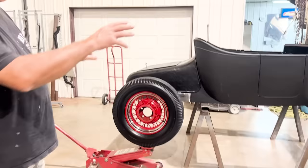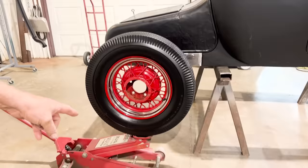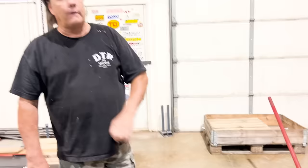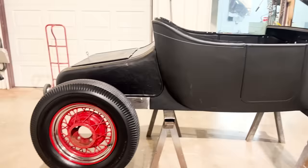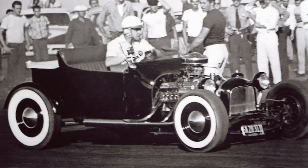I cleaned the old tires and wheels and armor-all'd them. I want it to look fairly cool. I've marked it on the ground - the front of my jack wheel at 99, 102, and 105 inches. Ed's is 105. I've got the front wheel positioned from the firewall the same place Ed's was, so that's a given. I'm not going to change that. Back here I'm kind of liking the shorter wheelbase better. Traditionally a T-bucket was a little short thing - the Ivo T and Norm Grabowski's T were very short wheelbase. They were just little hot rods.